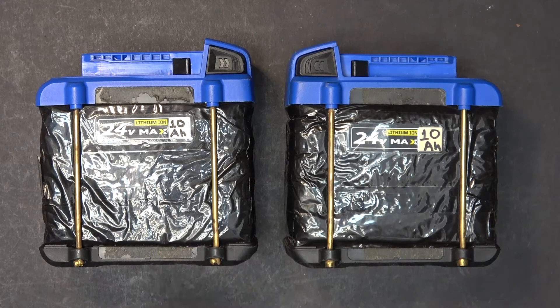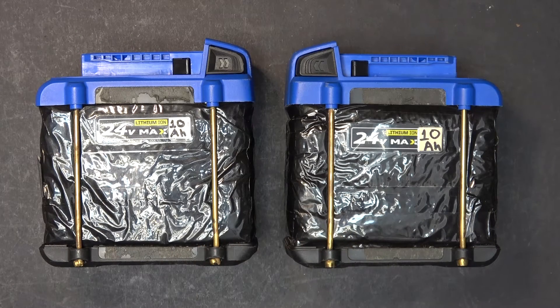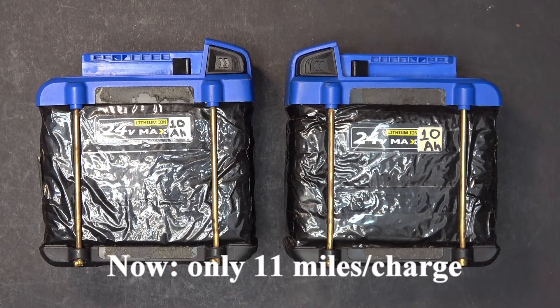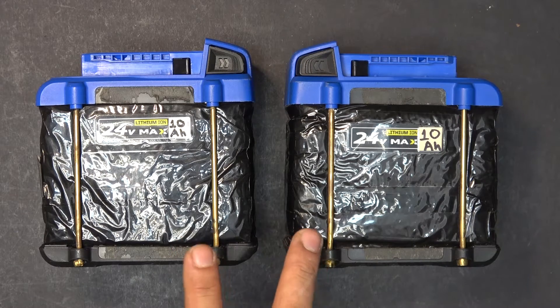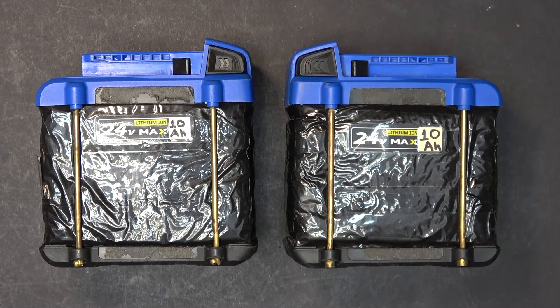The third disadvantage is battery degradation. These batteries are meant to put out a lot of power in a very short time, so their life expectancy isn't great — it's like a rockstar that lives fast and dies young. When I first put them on my e-bike I got about 15 miles per charge. Now, after six years and 2,000 miles, I get about 11 miles — they've degraded to about 75% of original capacity.